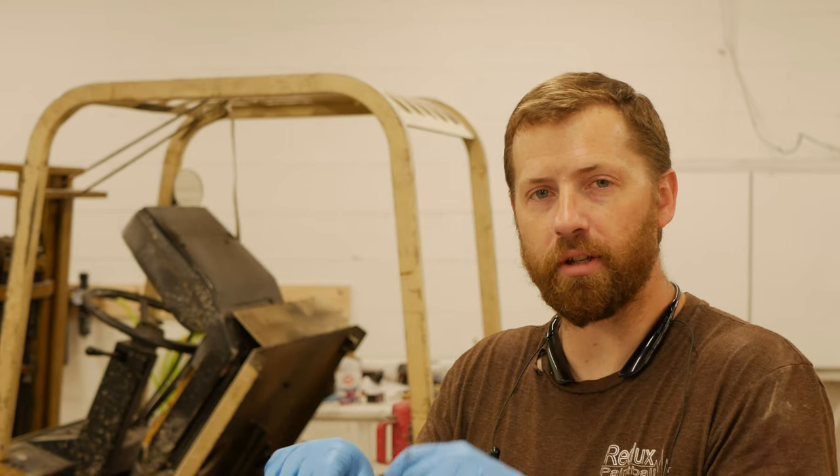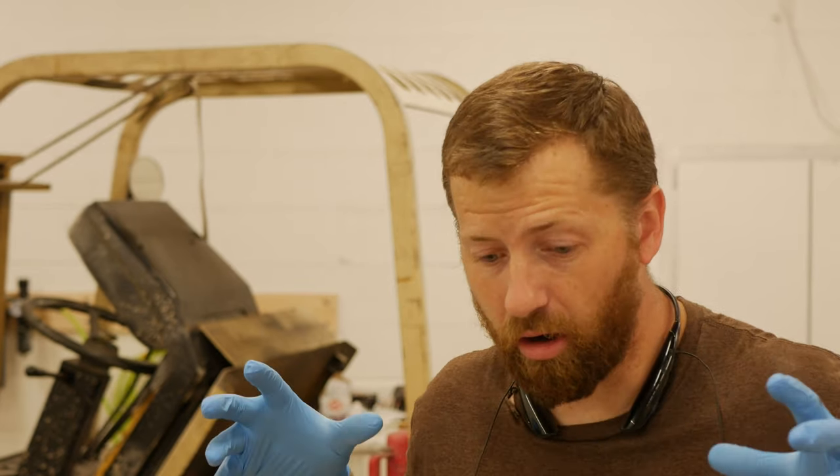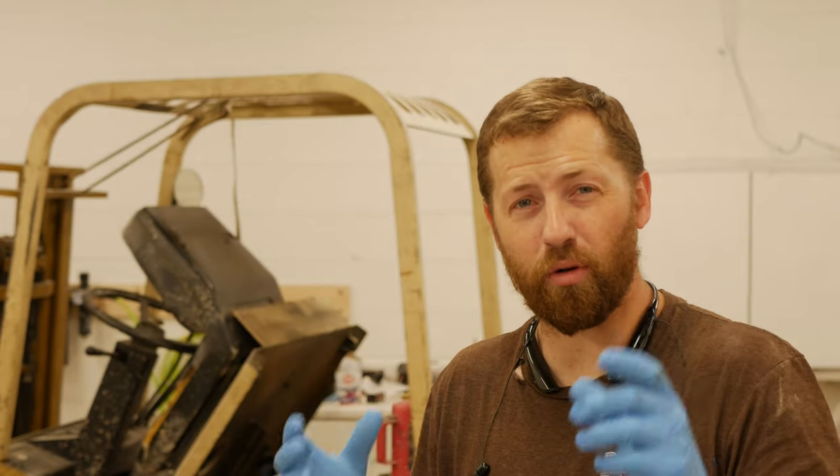That electricity needs to flow from the coil through there, so that way it can jump the gap on those points when necessary. Also, the condenser is connected to that same ground terminal on the outside of the distributor housing. It's kind of like a surge tank or an expansion tank for electricity, if you will, from those gaps in transmission of electrical current through the spark plug. So obviously they're not all firing constantly and shooting a spark constantly, so there's pulsing of that electricity, and that electricity has to have somewhere to go without damaging components, and that's what that condenser or capacitor is for.